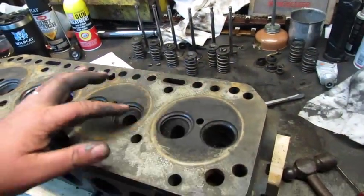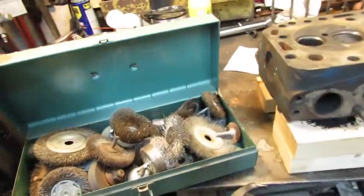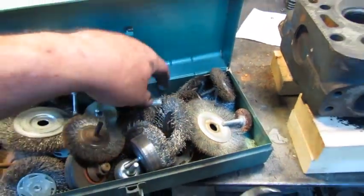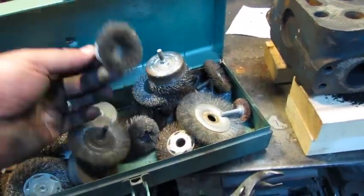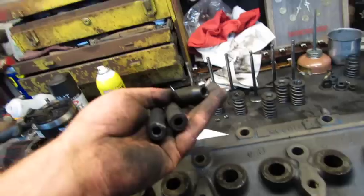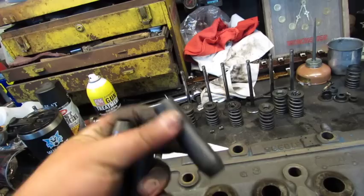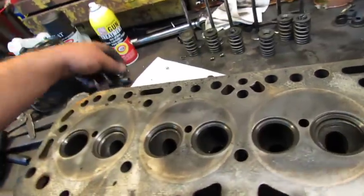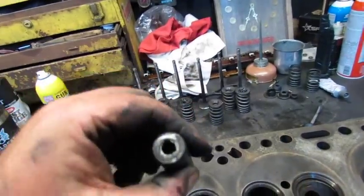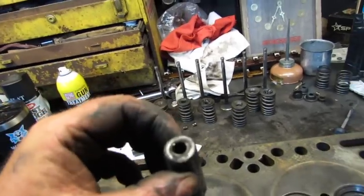I think I'm gonna take a wire brush and clean up these seats. What I really need is some more items organized in my shop - I just had to dig all that out to find these, which I bought at a pawn shop or auction. Maybe that one's just the thing - those are the guides. It boogered up the ends - I think those are the intake ones. Let me double check - one's longer than the other - yeah, the intake ones are longer. They're harder too, because it boogered up the end of them, but not the exhaust ones, at least not as bad.